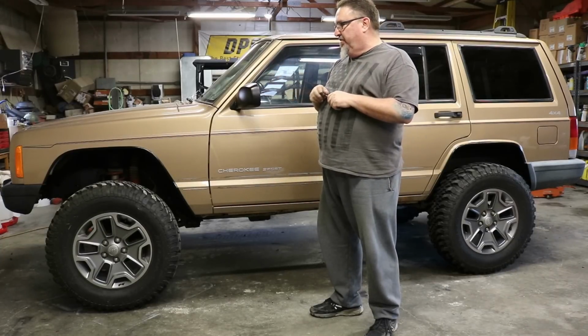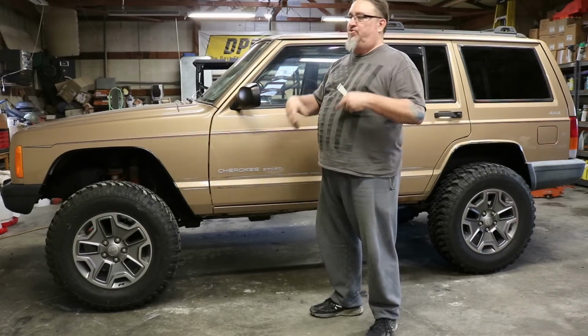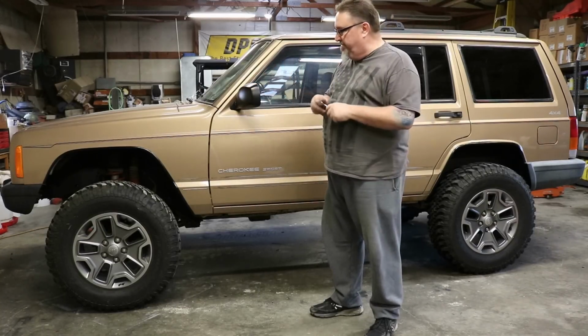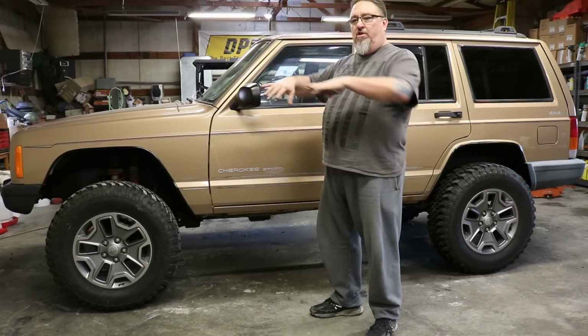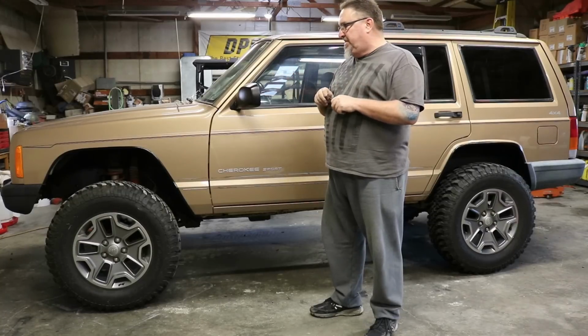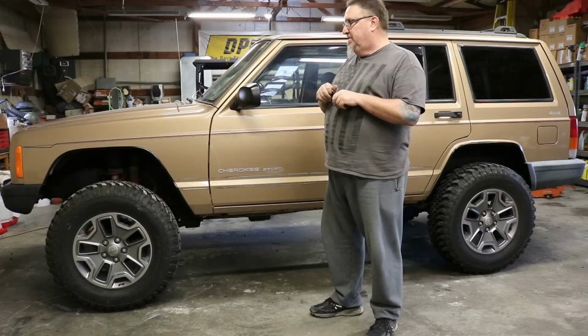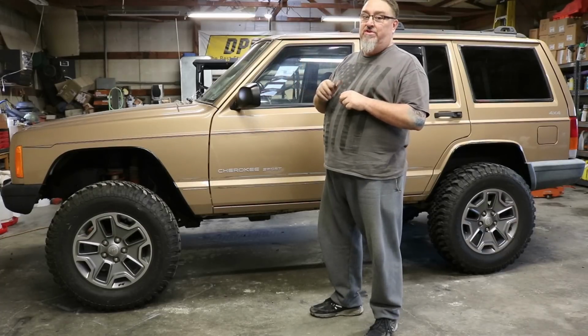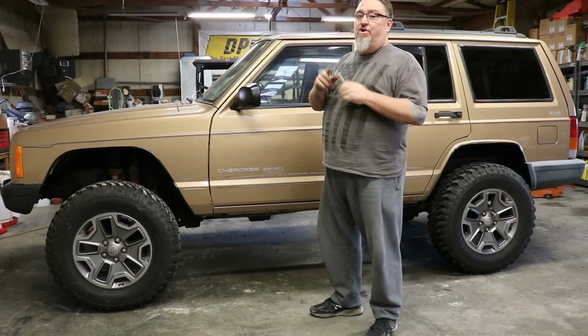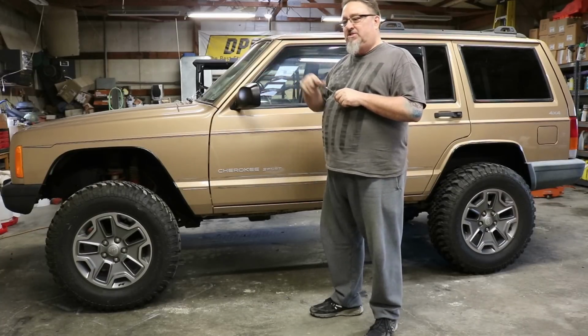Ride quality suffers. You start having to spend more money, maybe at a certain point, on long arms and drive shaft modifications, slip yoke eliminator. We keep the lift smaller, make more room in the fenders, much better, much more stable, lower center of gravity. This is the way that we do it now. 6.5 inches of lift for 33s. We just, you know, to each their own. If that's what a guy wants to do, we don't do that anymore. We keep these as low as we can.